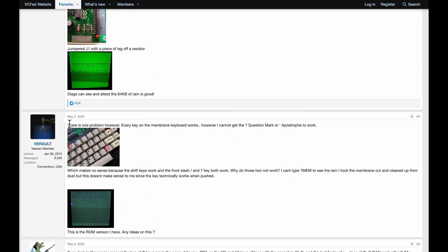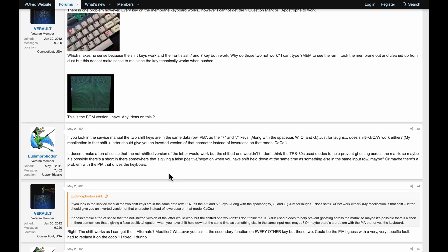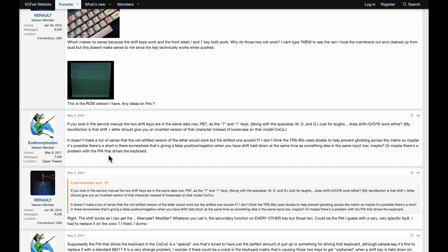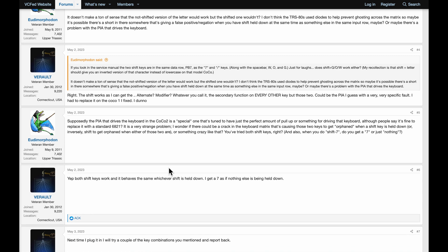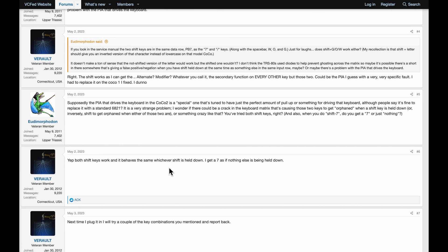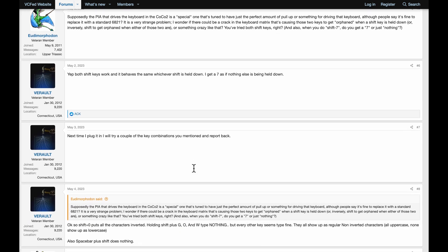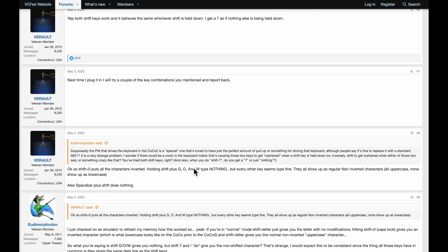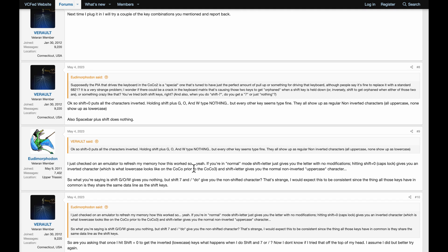The memory is working perfectly and I was able to play some of the newer games. But then I had an existing problem on this CoCo — certain key combinations don't work. The memory program that comes with the upgrade is where I first noticed it, because you're supposed to push a key combination like Shift and the question mark, and that wasn't working. After doing some searches, I found someone from 13 years ago with the exact same problem on a CoCo 2, so I realized I had a problem with the mylar and decided to order the KeyFix 3.